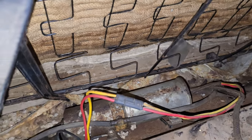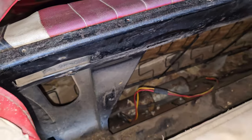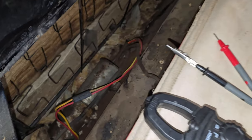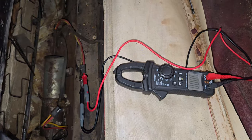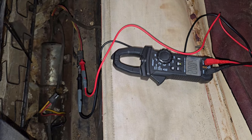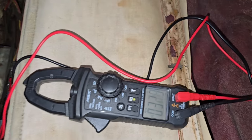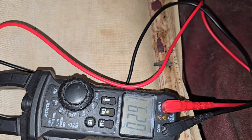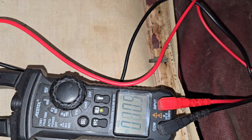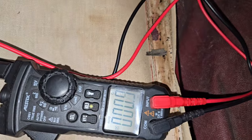There's our pump — that's the pump that controls the convertible top. We got a voltmeter out here and we're going to check for voltage while the switch is being pushed up front. The results are not looking good; it's very confusing — never seeing 12 volts back here for some reason. So we're going to have to go up front and do some troubleshooting by the switch.